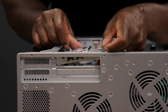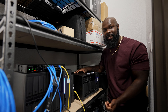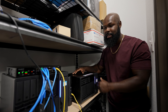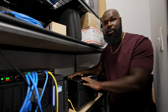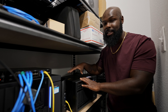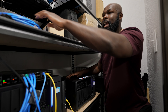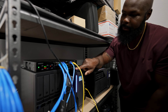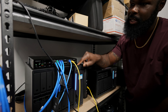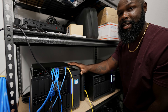The other NAS I have is an H1288X. This is an 8-bay NAS with four SSD slots and two M.2 slots inside. I have this configured with 176 terabytes. The only thing we really needed to do for the setup to get this communicating with the network is plugging in a 10 gig ethernet cable. We'll plug directly from the back into an open port, which will allow this NAS to communicate with everything on the network at 10 gigabit speeds.